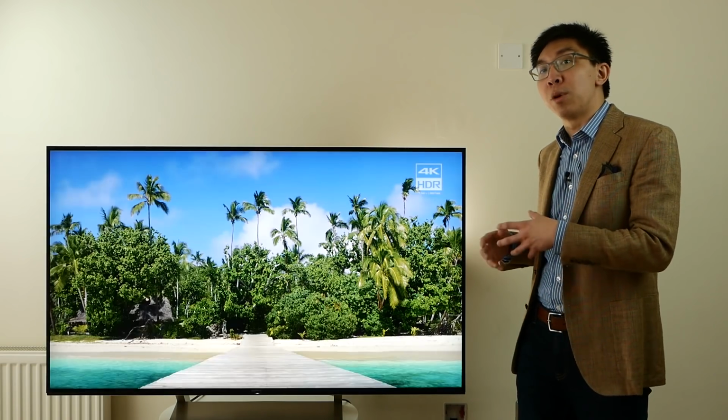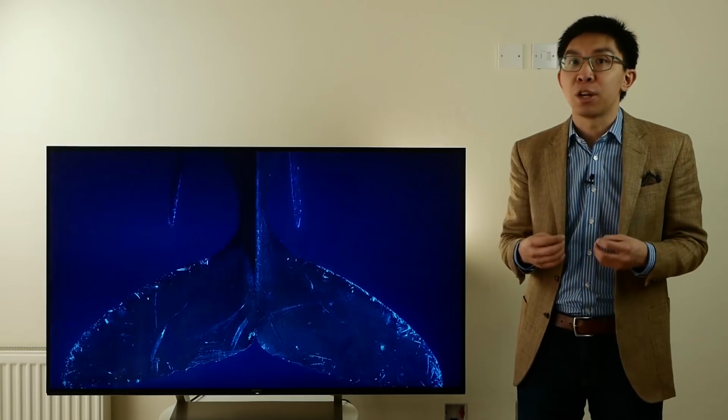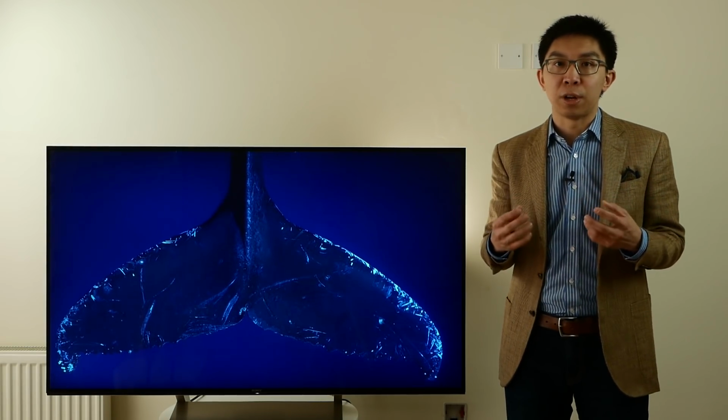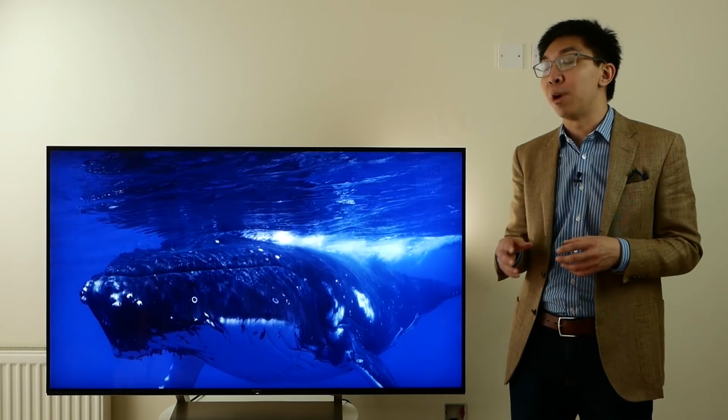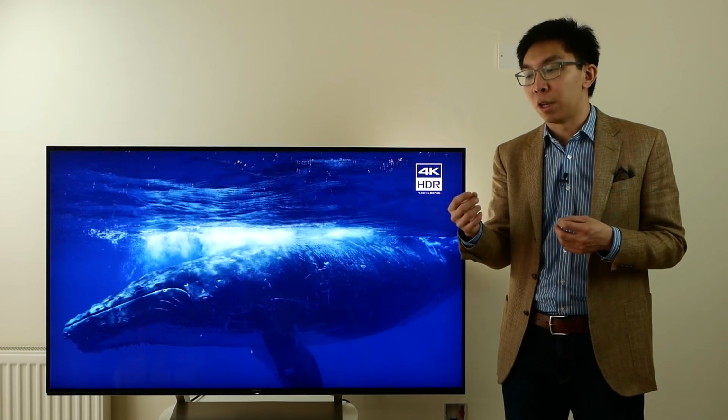Like all Sony TVs reviewed so far, the Bravia XE93 still doesn't offer any advanced color management system or CMS. In the past, we've never really found a need for it because once grayscale gets calibrated on Sony televisions, the colors generally do fall into place quite nicely. However, the ZD9 was the first Sony TV we wish we had access to a CMS, and it's the same with the XE93, probably because they share the same underlying X1 Extreme chipset.